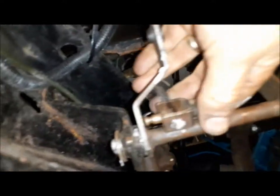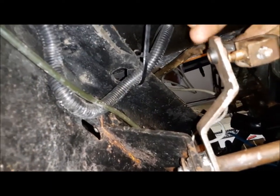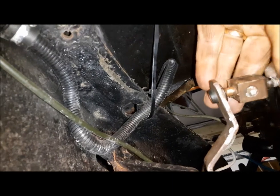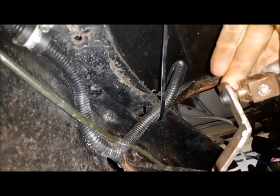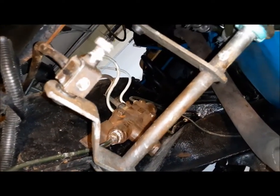We're going to start by adjusting the column shift linkage. We've got the transmission in neutral and the column shift in neutral too, so we just get that lined up and pop it in. You can see it's right at the end of the rod — that means this truck has got some pretty decent body mounts, it's lifted the cab up a tiny bit — but it doesn't matter. It may be at the end of the adjustment range, but it's still good and safe. There's still a little bit sticking out the other side, so we caught it. Now I'll go upstairs and make sure it shifts nice.